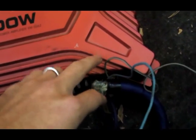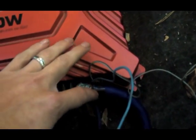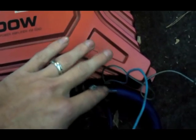Talk to Toolmaker or Project DB. Get you some terminals. Also, don't use different size power and grounds. Use the same size. Also, obviously, that is a stupid idea. You find a bolt or your strut tower. I like the strut tower the best, but of course they're kind of hard to get to. Scrape the paint off. Tape doesn't work.